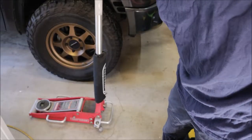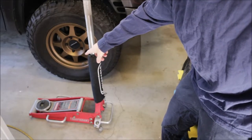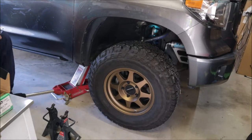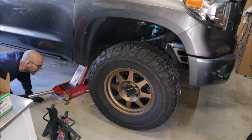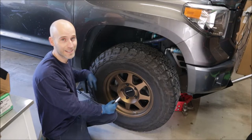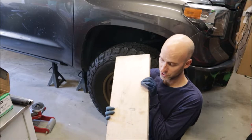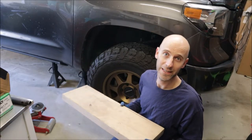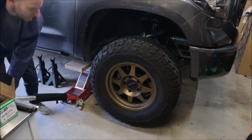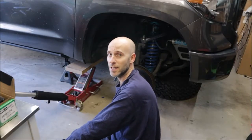We're going to put the little Craftsman two-ton jack through its paces today, but we're just going to do one corner at a time. Got to take that wheel off first, but I need to get this corner up in the air — safety first. We're going to crack the lug nuts loose while it's still on the ground because that tire is just going to spin when it's up in the air. I have some super thick stout wood I'm going to put into the frame to get the clearance for the jack to lift the tire off the ground. It's on two jack stands with the wheel underneath — most of the weight is off the jack, but I'll leave it there as an extra catch point.